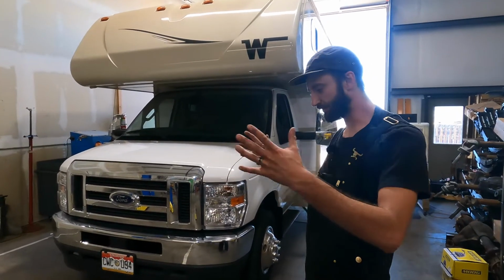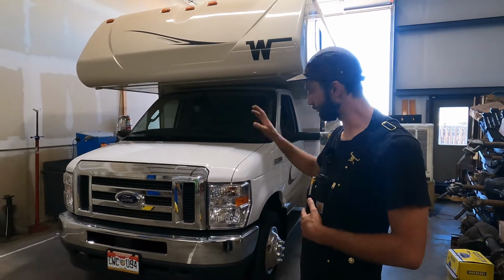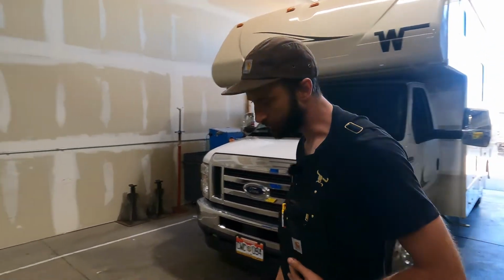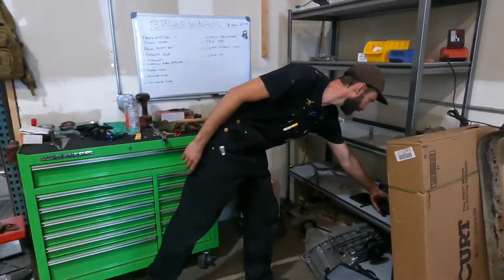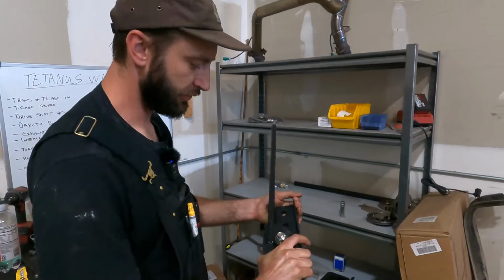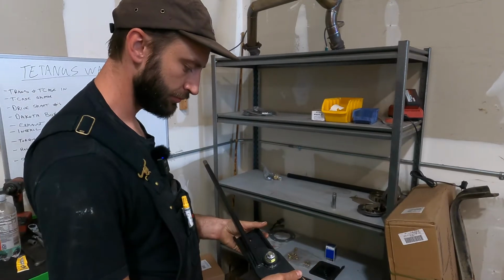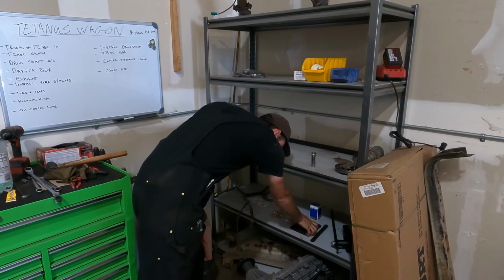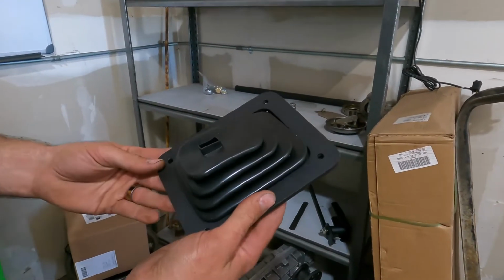So we just take that same manual shift transfer case from behind that transmission and it bolts right up to the back of your transmission. And then we have our own proprietary shifters and everything that you can see here that we manufacture in North Carolina. This just bolts to the transmission right in a factory location, allows you to shift through all the different 4-high, 4-low, neutral. We have nice little trim rings and everything. It makes everything look nice and stock.